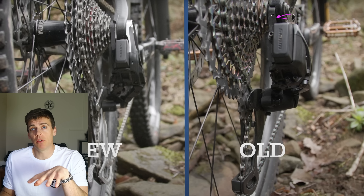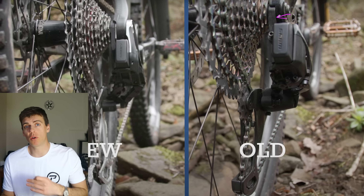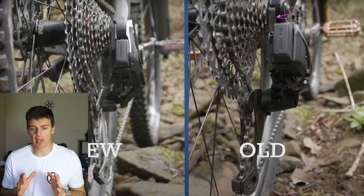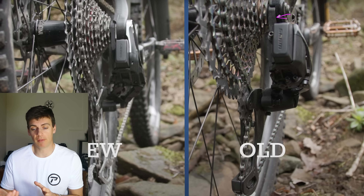This is the new one on the left. It's got what I call a clevis clamp arrangement. All the other mechs in the world bolt to a sacrificial thin aluminium plate called a derailleur hanger. The derailleur hanger is exceedingly important — not just to break when your mech takes an impact so it doesn't damage the expensive carbon frame (which at the dropout is not repairable) — it also provides what I call a datum interface for your shifting indexing. When you take the wheel out and put it back, or take the mech off for travel, your shifting index won't change because the mech hanger doesn't move.